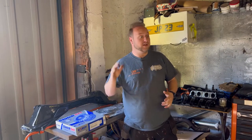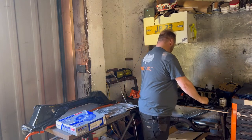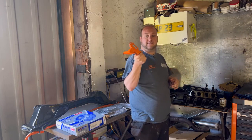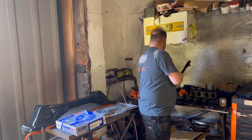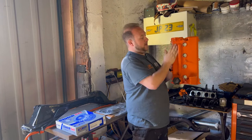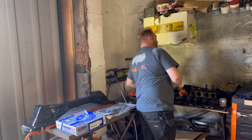On a new day now. Last time I was up here I spent a solid eight hours straight just cleaning, wire wheeling, cleaning some more, degreasing and powder coating loads of parts. I've got bits like the inlet manifold - done all three parts in black. I also have these random brackets which obviously just come off the engine, done some of the bigger brackets in orange. Here's the tensioner for the auxiliary belt that goes around the alternator and the aircon compressor. Then there's these two random supports which help support the inlet manifold off the block. And then obviously the other biggest part I've done is the rocker cover.